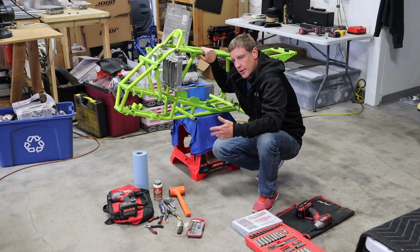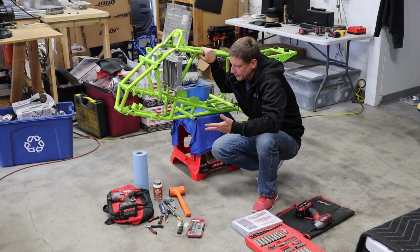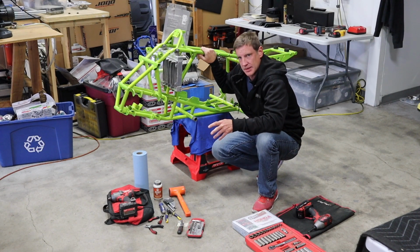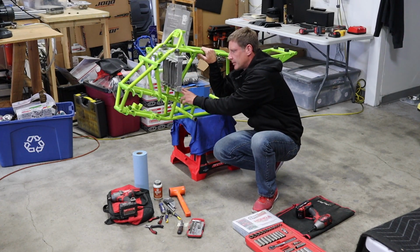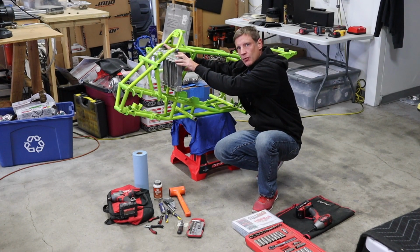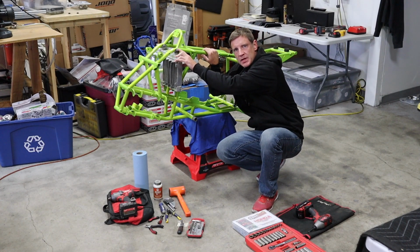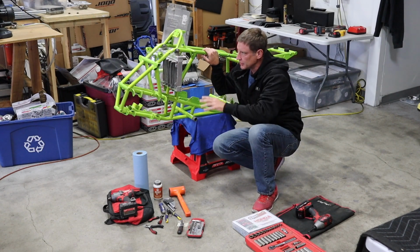I don't think there's a right or wrong order of building a quad. In fact, I never use the same order. Sometimes I start with the front, sometimes I start with the rear. The only thing I kind of do consistently is I get the radiator in. So that just slides in, down in the posts. I'll put on my 2 brackets. I'll tighten the inner one, the right side. The left side I'll leave loose. I won't tighten that bolt because I know I need that for ground and connections there. So I'll leave that alone.